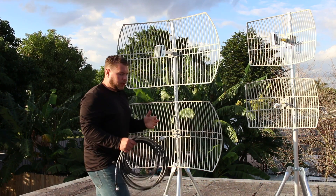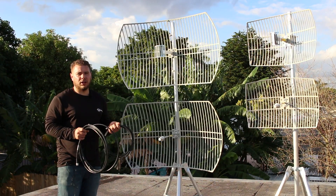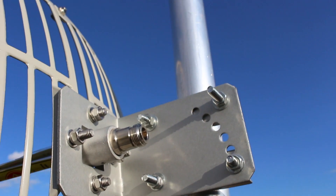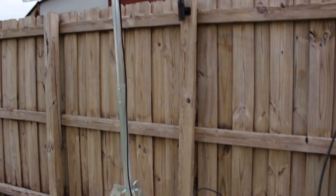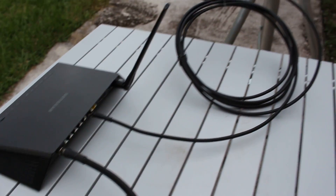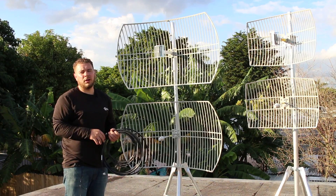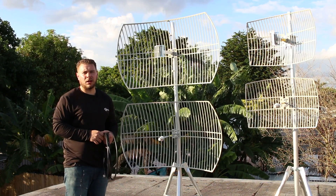Using two antennas with two different frequencies, with two cables — one for each antenna — you can plug directly into the back of these USB adapters. Those USB adapters use SMA-RP connectors, and N-type is the connector you'll want on the antenna cable. Most routers on the market today — Netgear, the new TP-Links, ASUS, Buffalo — all have SMA-RP if the antenna is detachable, allowing you to connect high-gain antennas and achieve very high speeds over long distances. If you have any questions, comment below or email us at support@simplewifi.com. Thanks!